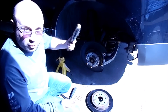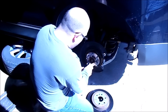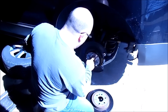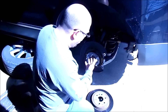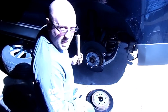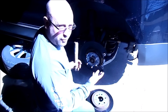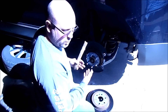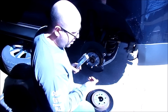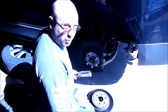Since I actually couldn't find my drill, we're just going to hit this with a wire brush quick. I'm actually going to pull the brake fluid reservoir cap off. That way, when we compress the caliper, if there's any pressure from the caliper being compressed, you won't have an issue with that pushing back on the cap. Then we'll clean up the rotors, get the pads ready, and get this back together.